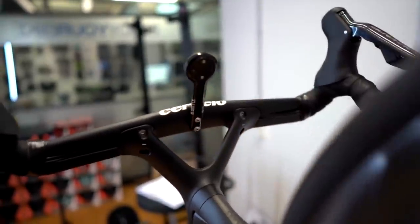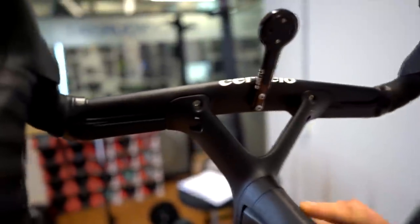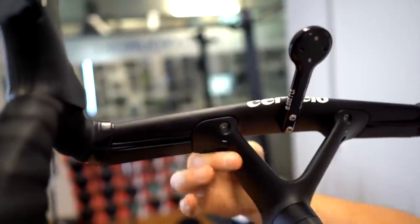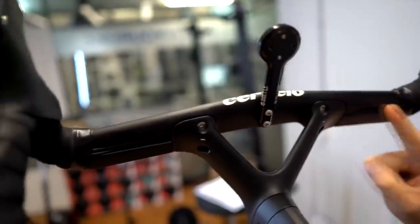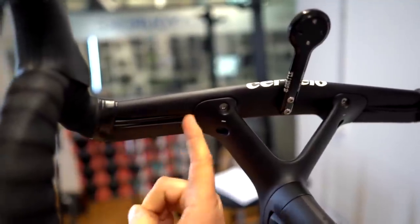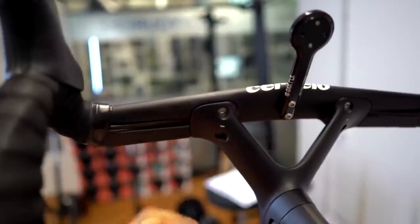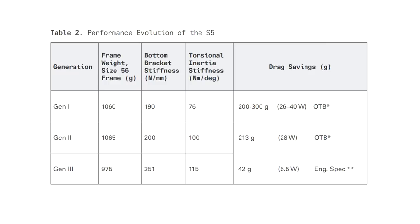The reason I'm highlighting this particular bike today is that Cervelo have taken it extensively to the wind tunnel, and all the results are out there in a white paper you can download — I'll put the link below in the description. The headline is that the aero savings of the entire bike are actually quite modest compared to the 2014 S5 (version 2). The savings are around 5 to 6 watts, or 42 grams of drag.